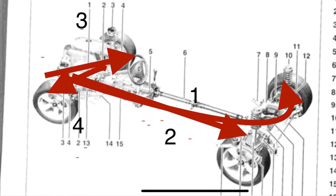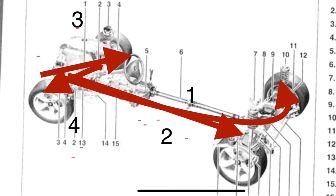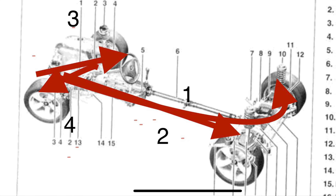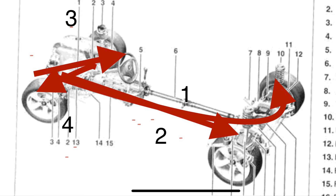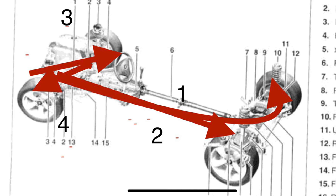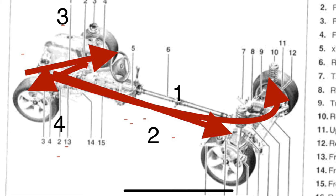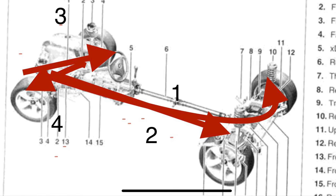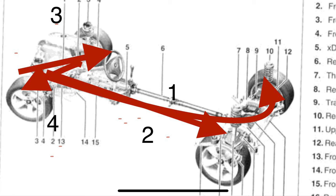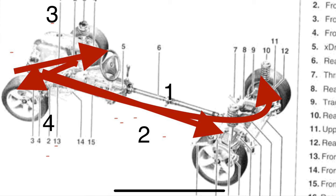What is the order of bleeding? Which wheel is the first to bleed? You want the longest brake pipe to bleed first, because the longest pipe has the higher pressure, and the shortest pipe is the last to bleed because the shortest has the lower pressure. In this order, we avoid the air in the brake fluid entering the previous brake pipe, which has already done bleeding.